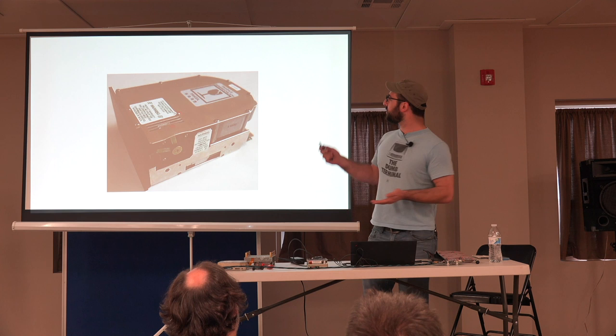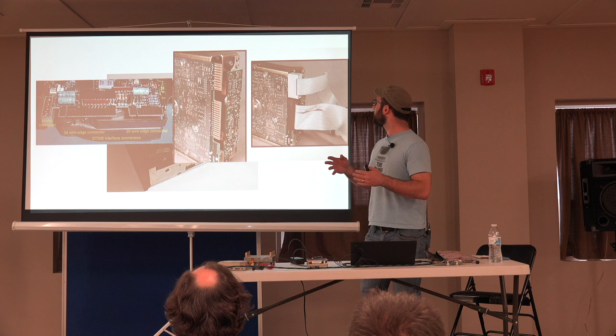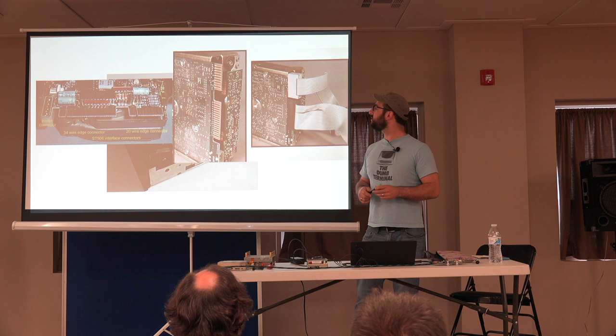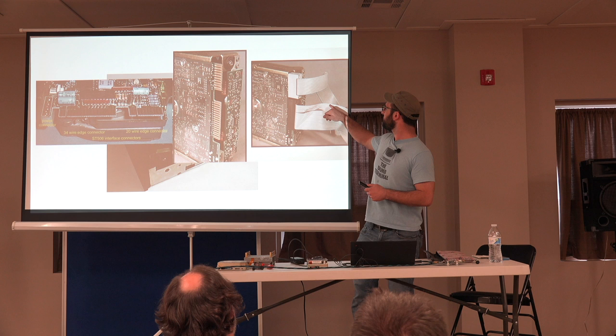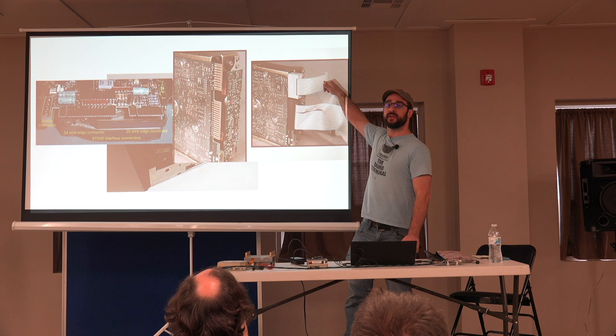To hook this thing up, Seagate adapted a floppy disk type interface. If you ever have taken apart a machine and you notice the hard drive has two cables, and generally it goes onto two edge connectors, it's an ST506 drive. The wide connector is the control signals from the disk controller, and that's an important point. The smaller cable is the data.